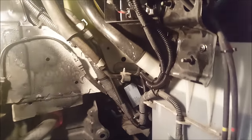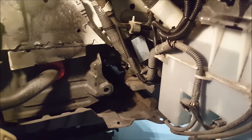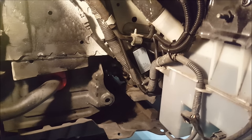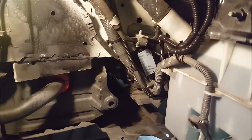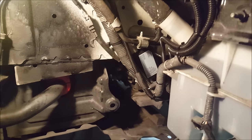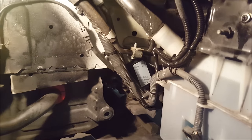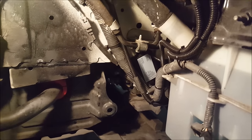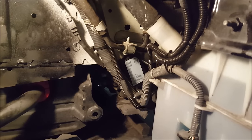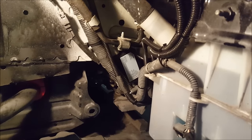One thing to note: I could not get the turn signals to just flash amber on their own. The way this module works is it's timed — when it sees the daytime running lights or main power on, and you start interjecting the turn signal, it will see the flashing and switch over to amber. Unfortunately if you just pulse everything together once, it just pulses white. So this would work fine as a DRL, but I don't want to run these all day long. This will be a nighttime-only application for me, but depending on how you wire it, you could have it on with your parking lights — however you see fit.